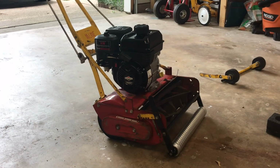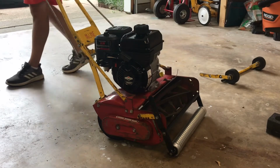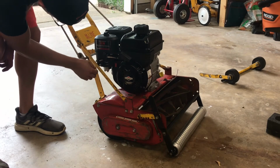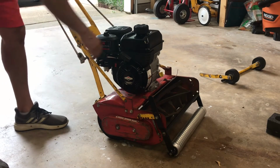Alright, everything's buttoned up. Reel's on. Put the deflector back on. Belt's disengaged. We got fuel, we got oil. So now we're going to give it a start here. Turn ignition, choke, turn the fuel on. Go to full throttle. Choke's right there.